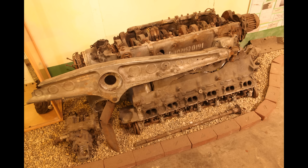Next, they added a three-speed supercharger drive, and this did put it ahead of the Allied systems, at least most of them. Typical V-12 powered fighters in the European theater had one or two speeds. You may remember from the chart earlier that third speed really helps keep power and thus performance up at higher altitudes. So we have a great supercharger system, but performance will of course be limited by the relatively low octane German fuel.